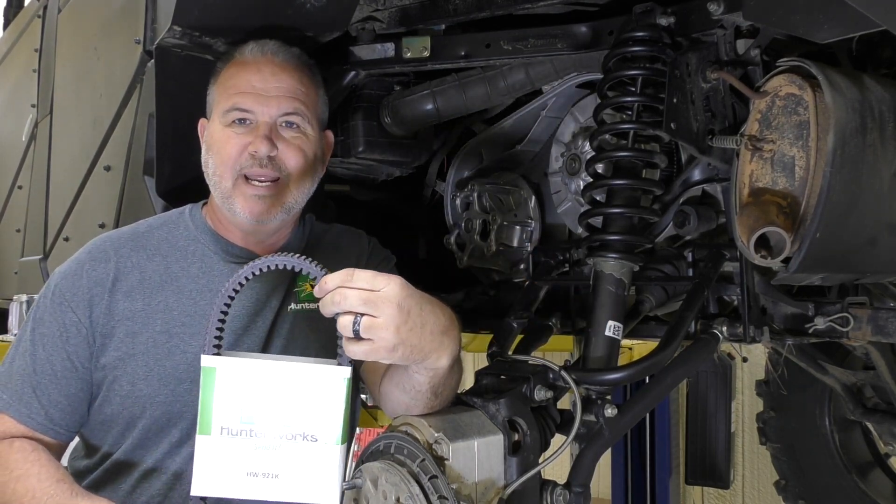You don't have to worry about an EBS tearing it up because it's got a regular two-way bearing in it. You might say, 'I'm going to lose my engine braking' — no you're not. You get engine braking down to three to five miles an hour. Your EBS secondary, the way the secondary functions, gives you engine braking down to that three to five miles an hour, and after that you go into a little bit of freewheel as you step out of it.